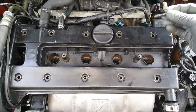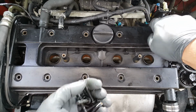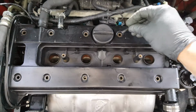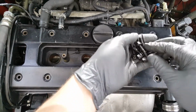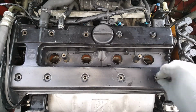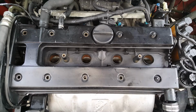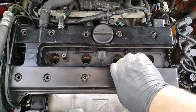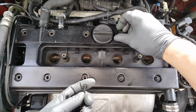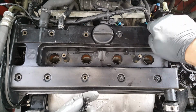Okay, and now I did clean these off with a little bit of gasoline. Get all that old oil off there. I've got that RTV setting up over there. I don't want to just go to cranking down on it, or it's going to just squish it out where I put it. So I'm just going to loosely snug them down with a little 1/4 inch ratchet for now, and I'm going to come back and we'll torque them down to about 70 inch-pounds.